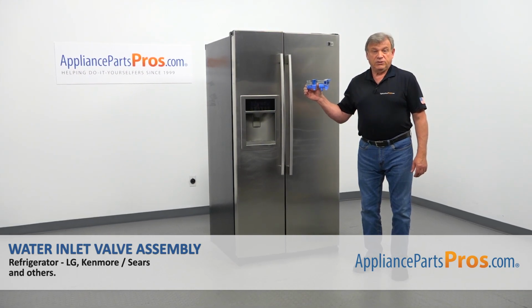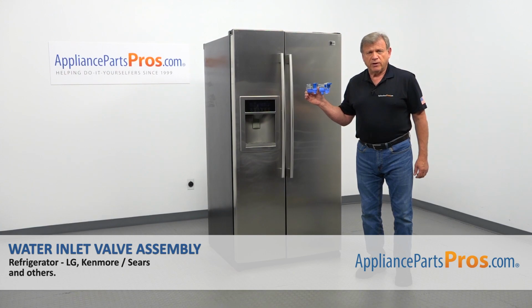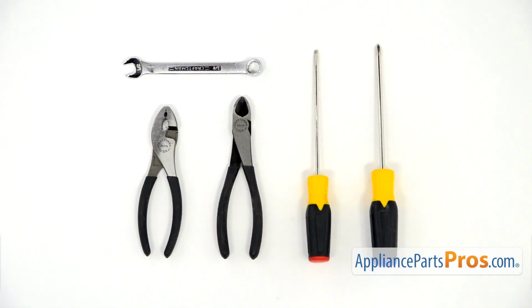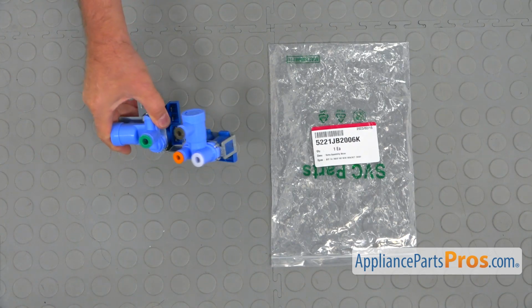In this video, we'll show you how to replace the water inlet valve in an LG refrigerator. It's going to be a very easy repair. It should only take a few minutes to show you how to do it. For this job, we're going to need a 1/2-inch open-ended wrench, Phillips and flathead screwdrivers, side cutters, and a pair of pliers. When you open up the package, you're going to get a new water inlet valve assembly.